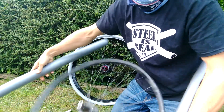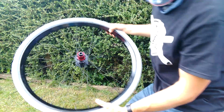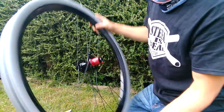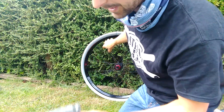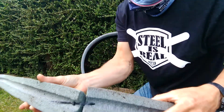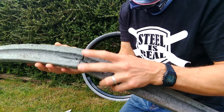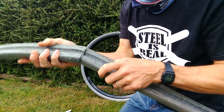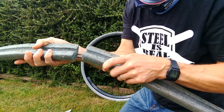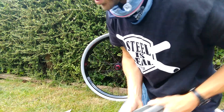You'll pull it all the way around and measure it and do the other side accordingly. What you've got then is the two halves - you've got two joints. I've experimented in the past with joining them using a zip tie just like that, but you don't get a very tight fit around the rim. If you're running low pressures, it will move and slide, and it will pop and break. I found that to be unsatisfactory.